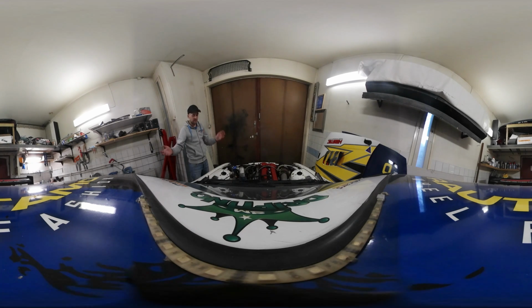I have a 3-inch drive shaft. It's a BMW drive shaft welded together with an S14 drive shaft. Easy. And in the back I'm running a 4.3 diff from an R200 Skyline, and I also use Skyline drive shafts. The front brakes are also from a Skyline, I think an R33 GTS, 280mm I think. For coilovers I'm using BC Racing with the external fluid boxes, BR model, in front and rear.